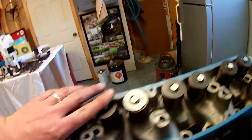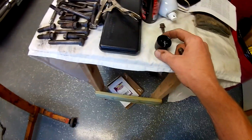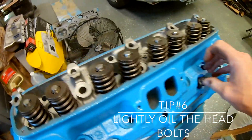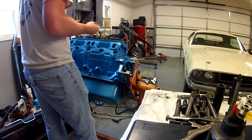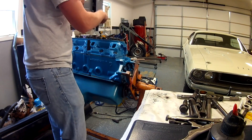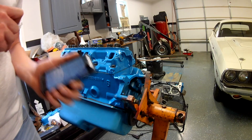If this was a race motor I would probably buy nicer gaskets — it's just going to be a little street hot rod, nothing special to it. Very mild 360, I would call it. For the head bolts here, I just got a small cup of oil, just oiling the tips of them to get them started.